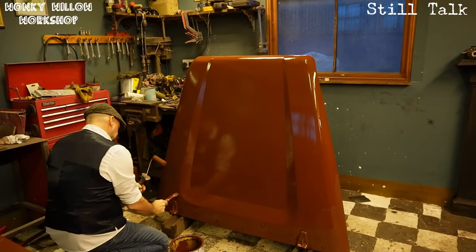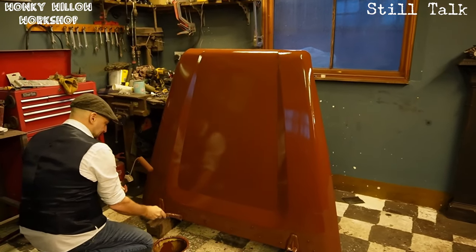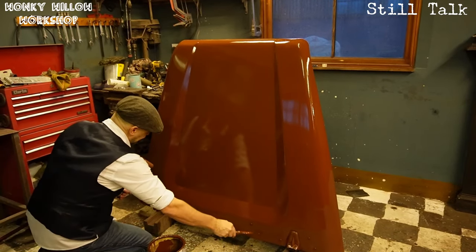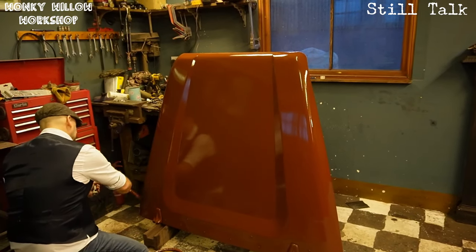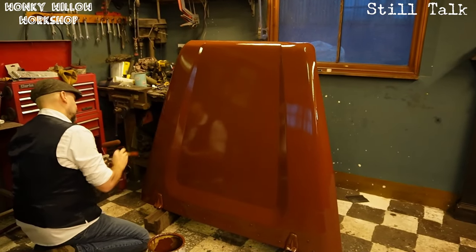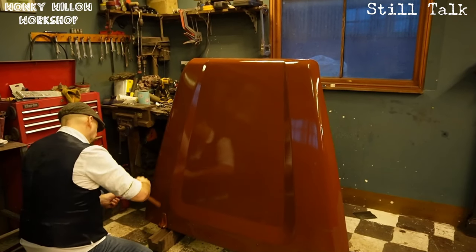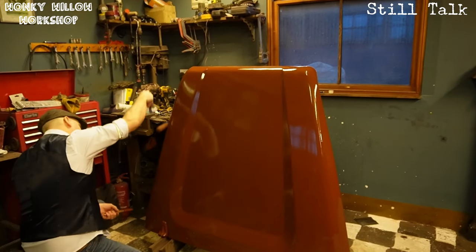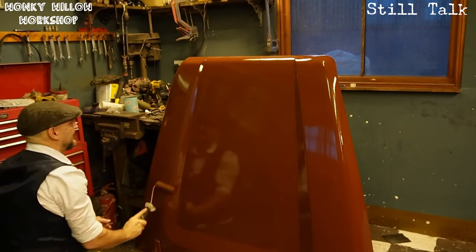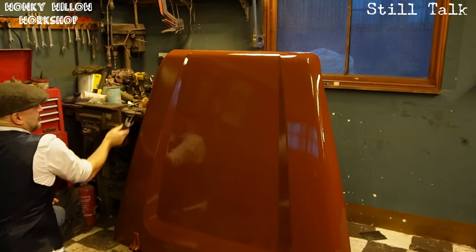We've got rivets here and we're on the vertical. I've painted the bottom of this bonnet before so I'm not going to bother again. Years ago with just a brush, if you were coach painting, these rivets would just be a problem. But the roller, because it stipples, it lifts it off. I can't stress enough: top coat will only mimic what's there — top coat will not hide anything. As you said earlier, it'll actually just make it look worse.